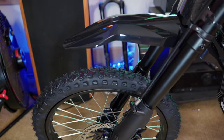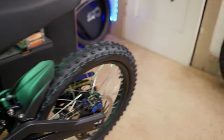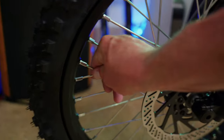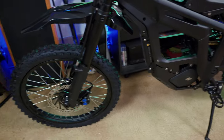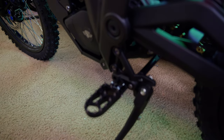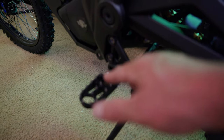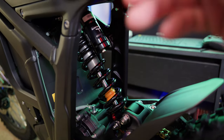The bike comes with CST tires you see on a lot of dirt bikes — the front is 19-inch 70x100 and the rear is a larger 80x100. The straight-spoke wheels look really beefy and solid. The Talaria also comes with CNC machined foot pegs. About 90% of people end up upgrading their foot pegs, but I think the factory ones on this bike are pretty well good enough.